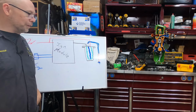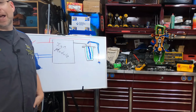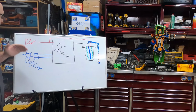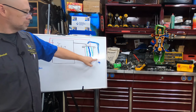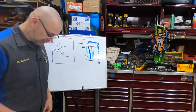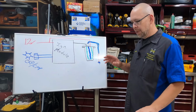Now, hopefully at the same time all that's happened, our piston has come up, compressed some gas, some air, some atmosphere inside there. We've injected a little fuel in it so that that spark has a job to do, has some work to do. Again, power, trigger, switching, secondary, plugs. If we have all of that, it works right at the right time, still something we're going to talk about, we get a spark.